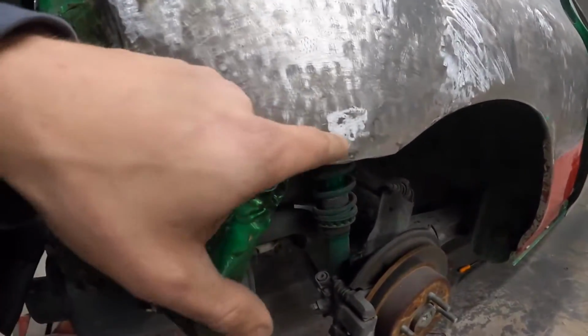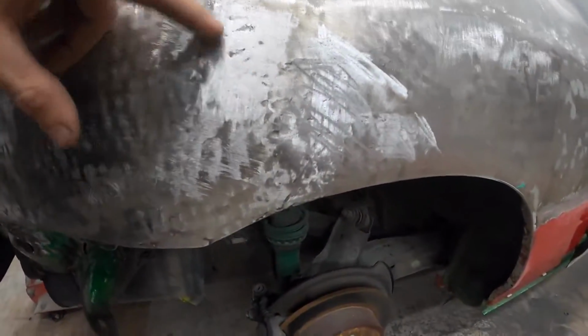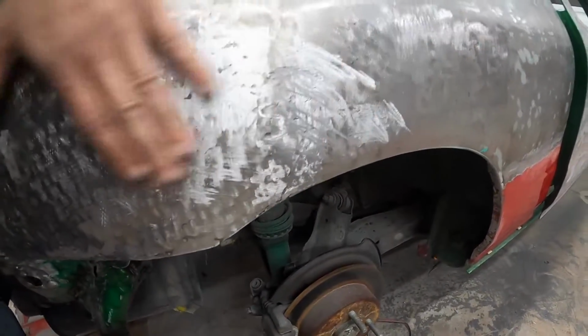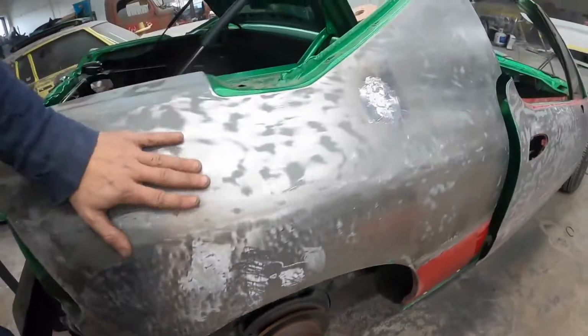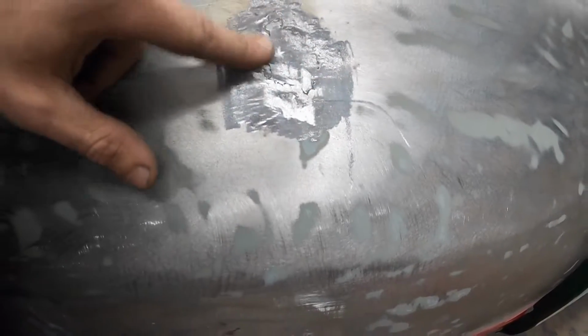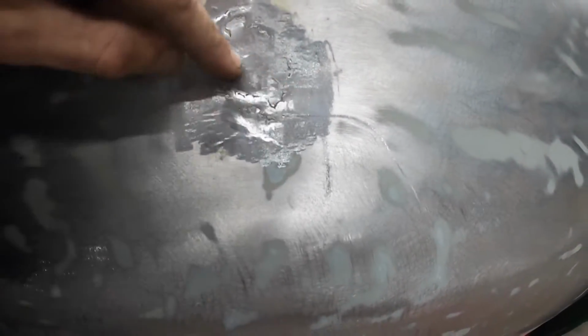I went ahead and filled some holes that I had, a couple little cracks, cleaned up this little groove a little bit. I filled it with lead, so it should be a bit smoother. Came up here, ground down their antenna, filled it with lead as well. I still got a little bit of grinding and cleaning to do on it, and then it'll be good. So now I'm going to go ahead and skim coat this whole thing. Couple spots I'll put a little bit of kitty hair just because it's tough and durable, and then I will skim coat the rest of it, block it, see how straight I am. I think I'm pretty dang straight, and then go from there.